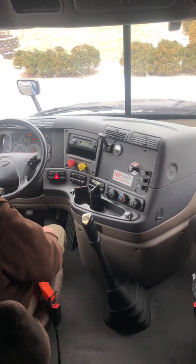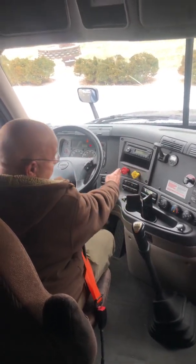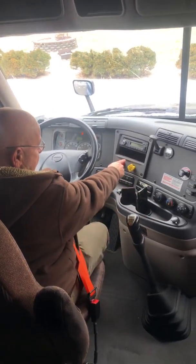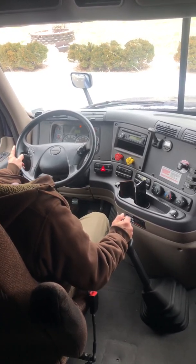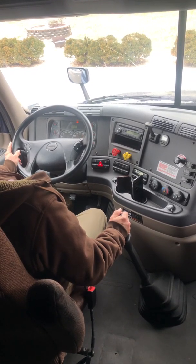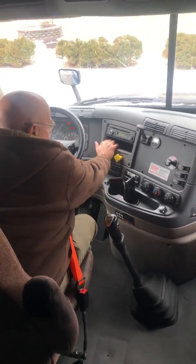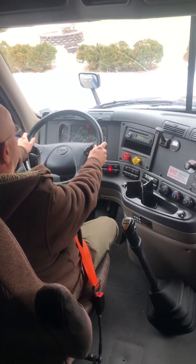Mr. Examiner, I'm now going to start my tug test. I'm going to go left to right again. Since this was on the left, I'm going to release my tractor brakes. I'm going to tug against my trailer brakes. Make sure they're holding. Now I'll check the tractor brakes by releasing the trailer brakes and tugging against them to make sure it's holding.